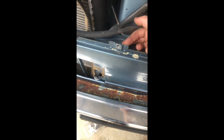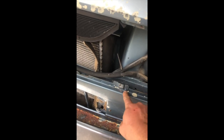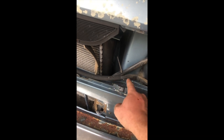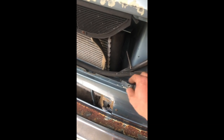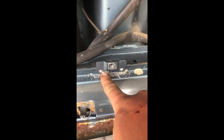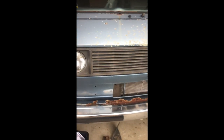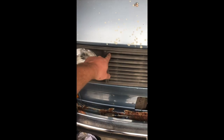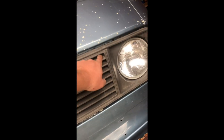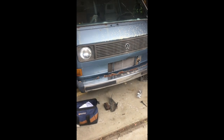The next issue is this bracket — it's specific to the square headlights and will interfere with the round headlight grill. Two options: drill out the rivets or grind into the back of the grill. I'm going to take the rivets out; you can always put them back in or find another one off a parts van. All drilled out, it pops right off. We're only using the outer screws; the middle ones don't go into anything. The bottom tab on this grill is actually broken, but it doesn't really matter since I'm not necessarily driving it like this — it makes it look complete.